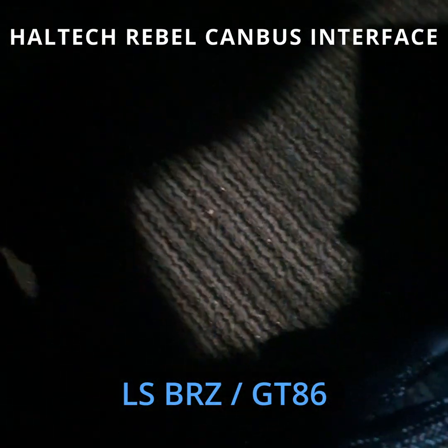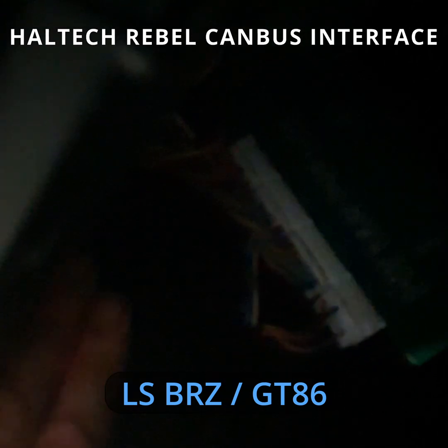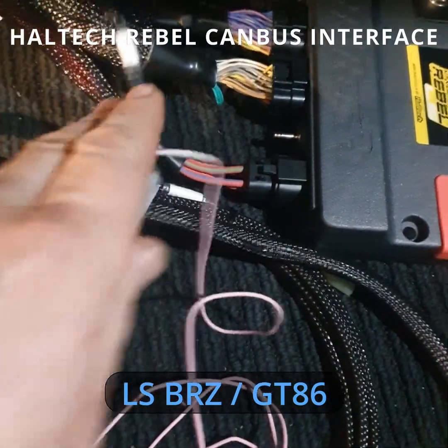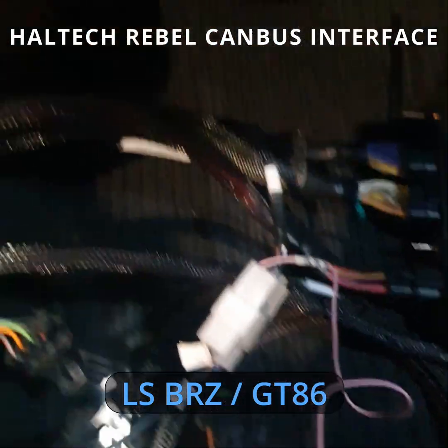We've plugged it all in now. As you can see, all four plugs on the translator are in - the two body plugs here and here into the car. The other two plugs we've tucked up underneath. Some people can remove those - all that wiring on the other two redundant plugs went to the engine bay in the FA20 engine, so with that engine not there anymore you can actually remove all the wiring and the plugs. We've also plugged in the Deutsch connector for the CAN bus, the ignition, and the pedal wiring, so the pedal wiring now goes through the translator.